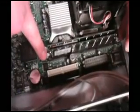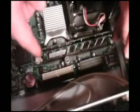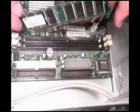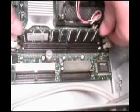The RAM is installed in the computer the same way, but in reverse. Notice the notches on the RAM card. Let these notches guide which way the RAM should be placed in the slot. If you are trying to install incompatible RAM, these notches will disallow the installation.